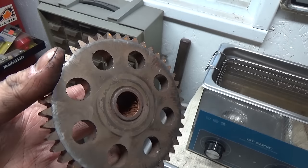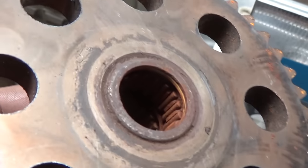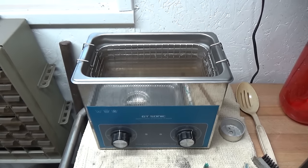If you happen to snap one of those little e-rings, the part number is 916-0231. Links are going to be in the description below. My little trick to free up these roller bearings is an ultrasonic cleaner — I'll clean out the solution, use some hot water with industrial strength degreaser, and put both gears inside to blast out all that rust and nasty stuff.